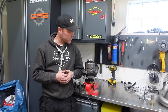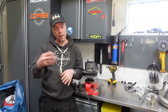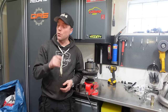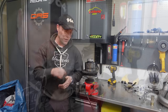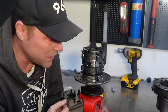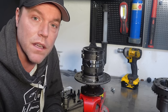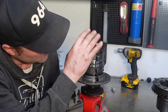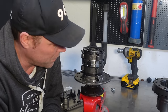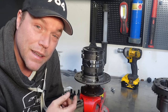Reading up more and getting input from the Porsche community, I think I'm going to stay at 100 newton meters. It's not a big deal if I need to adjust in the future — put the car on the lift, take the diff out with the gearbox still in the car. To adjust preload, you can increase the thickness of the steel plates by buying thicker ones to make it stiffer, or add a distance washer. To make it looser, buy thinner spacers or shift the order of the brake discs and steel plates.